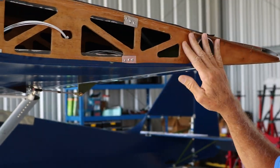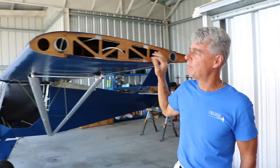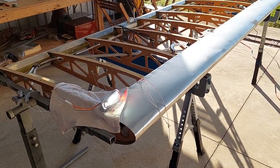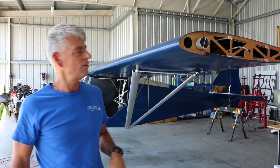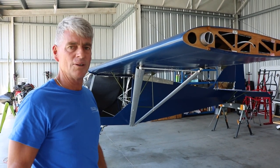The wing has a web spar, which is a design unique to the Aeropup, with extruded webbing running down the center of the spar. That gives it more strength and less weight compared to the typical hollow spar. The web spar carries the primary loads, and there's also a trailing-edge spar for rigidity. Each wing has 12 CNC-machined ribs from aircraft-grade plywood. The leading edges are aluminum, and the whole wing is wrapped — in this case with Oratex, though you can use any covering material of your choice.